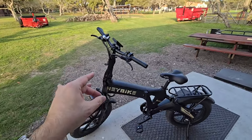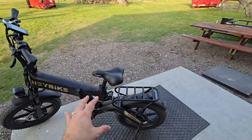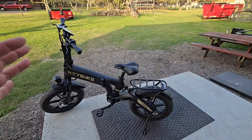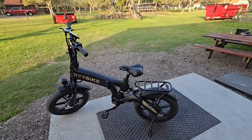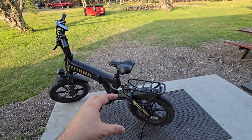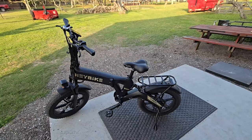I love the fact that it has a hydraulic front fork. Having a suspension fork is one thing, but having a really plush hydraulic front fork is another. This one feels really really good. The rear suspension definitely helps — you can absolutely tell it helps, even though you can absolutely tell when it bottoms out. If you go over anything really bumpy or rough, even my yard which is kind of bumpy, you can tell when it's bottoming out. So don't be surprised if you love the way it feels and then hit a bump and hear a clang in the back — that's the shock bottoming out. Shifting is really smooth, though in seventh gear I was getting a couple of misfires where the gear would skip a little. I'll try to fine-tune that — out of the box, that's just how it was. You can always adjust a bicycle's derailleur slightly to sort that out.